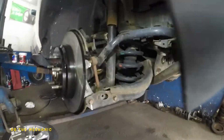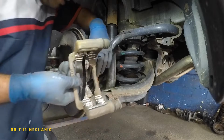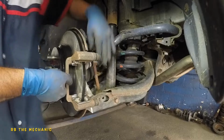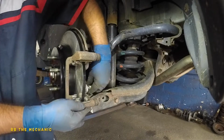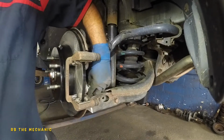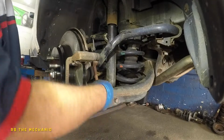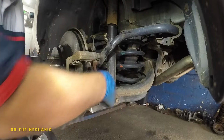Okay, that's that. Now what we need to do here is we have one in here, the 17 millimeters, put them on, grab the threads, turn as much as you can, and let me grab the second one right here. So this is 17 millimeter. Same process. I'm gonna turn this away because I did get a little bit of smudge of grease on this disc. That way the brake pad doesn't grip the area. Okay, there you go.